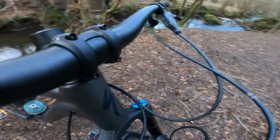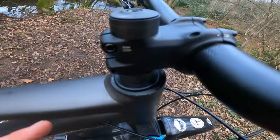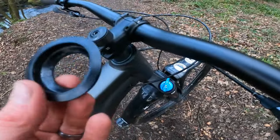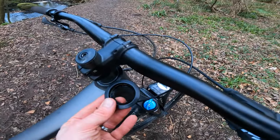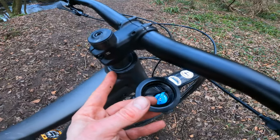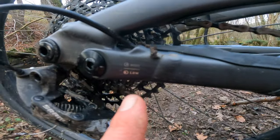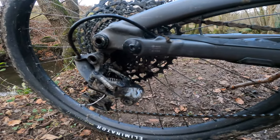First off — it's kind of difficult to see in there — but you get adjustable headset cups. This currently has the plus or minus headset cup in there, but it comes stock with this headset cap here. All you do is undo the stem bolts, undo the steerer bolt, slide the stem off, and change the headset cup. It comes at 64.5 degrees head angle as standard, but you can go to 63.5 — which is how I've got it set up here — or 65.5 if you fancy something steeper. And then at the back on the horst link, you've got a little high or low chip depending on whether that bolt is at the front or back, giving you another half a degree of geometry adjustment at the front.